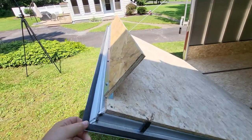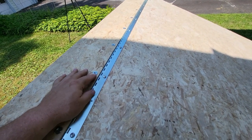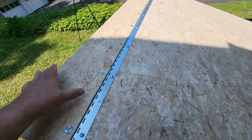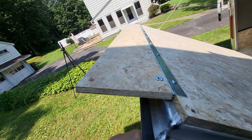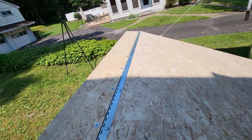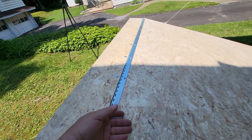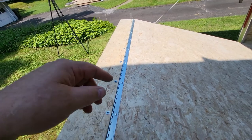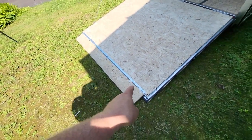Here's a key difference: I wanted the ramp flap on this. The Snow Pro was offering it, but their pictures show a curved end to the trailer. I wanted the flat flap because I can put the ski guide on here and reduce the chance of this leading edge getting damaged. Also, look at this piano hinge — it's flush. On the Mission and Snow Pro the piano hinge sticks up, and what happens is when you're loading your sleds, your ski skeg is going to cut into that raised piano hinge and eventually break it, damage it, or even pull it out. Because Proline gets this specially built for them, that's not going to happen.